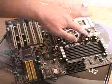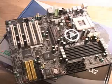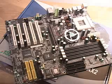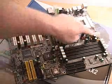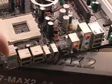There are four fan headers on the board — that's places to plug extra fans. Also you're going to need an AMD-approved power supply to plug into this board. There are two power connections, one right here and one right here. Right here is where you plug your PS/2 keyboard and mouse.